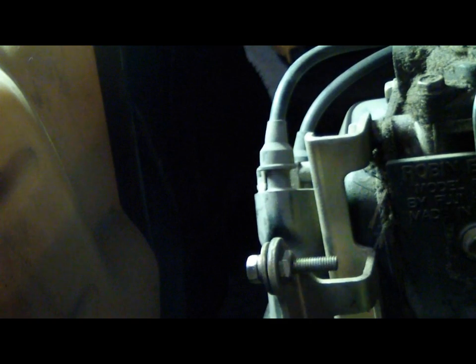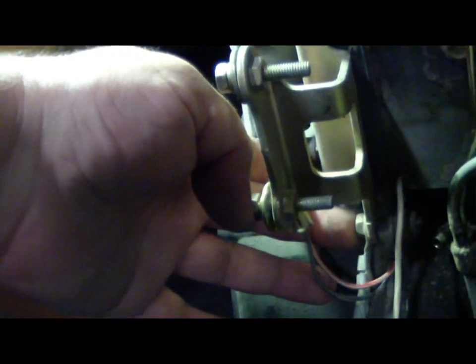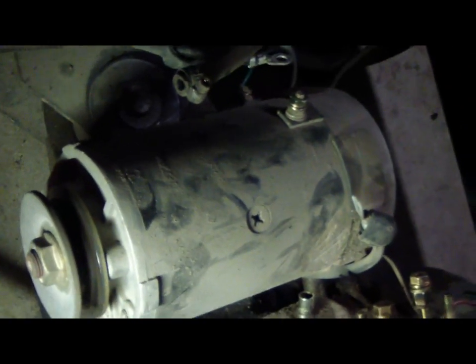And next I will unplug the coil and the other wiring harness from the engine. Move it off to the side. Farther down, there's a ground wire attached to here that'll have to be removed. I've also removed the fuel lines. Next, right below the pulley you'll see a bolt that runs to the other side. It'll take 2 19 millimeters to remove that, and then you should be able to pull the starter generator.